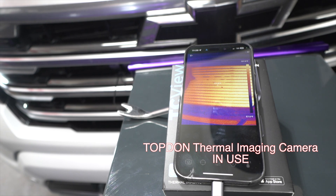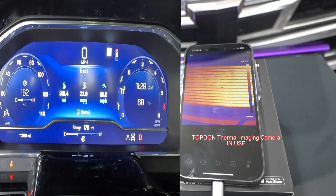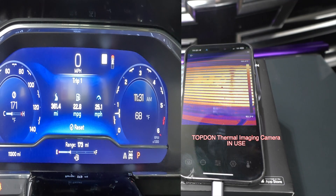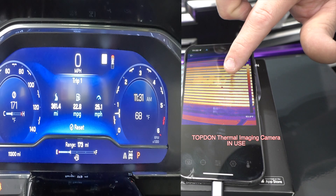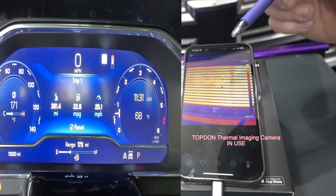This temperature will climb quite a bit. It seemed like it stalled at 169 degrees — and there we go. 176 is what that's showing. On my hand it's now cooler. So by 169 that has completely opened up — definitely not the 194 that I expected. Currently we're showing 167 right there. It's probably not visible in the camera, but I can see it right here.